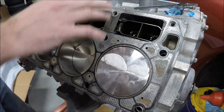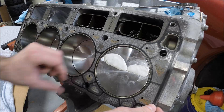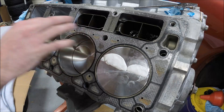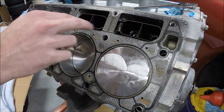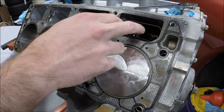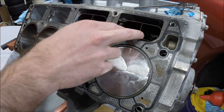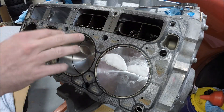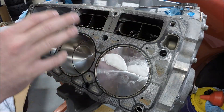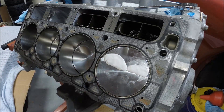So to do this right, we've got our short block assembled. I'm going to use my old head gaskets so they've already been compressed — I've measured those and I know how thick they are. If you haven't seen my video on how to make an old set of LS lifters into solid lifters, go back and check that out — that'll be very important here. We also talked about these in the video about measuring for proper push rod length. You should have already done that and have the proper length push rods for this step, measuring piston to valve clearance.